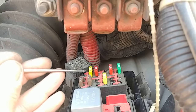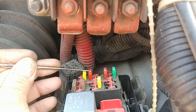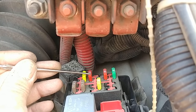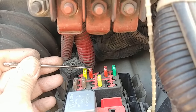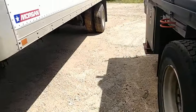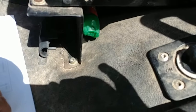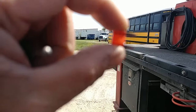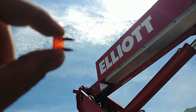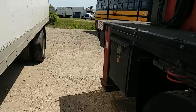That being said, the location that toned out was that 10 amp fuse. I test this side of the fuse and I've got power; I test the other side of the fuse and I've got no power. Now this is where it gets interesting — typically when you have a blown fuse you can hold it up to the light and see the element clearly broken in half.